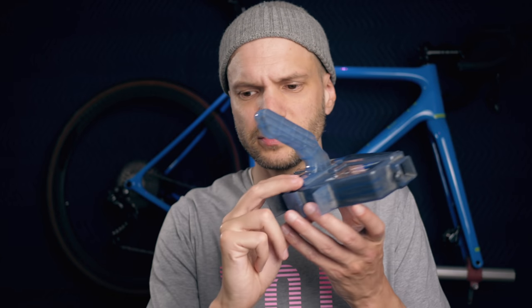For the occasions when I get caught in the rain, I carry a wet lube in a small bottle in my on-bike kit with my spares. It's pretty much a must if you use this specific lube, because it will just wash off in a rainstorm. However, that's actually a very good quality to have if you like to wash your bike after every big ride — it helps the degreasing go a bit quicker. The last couple of years I've been using the Park Tool Home Mechanic Chain Cleaner Tool. You can buy replacement brushes and sponges on Amazon, so it's a good combination.